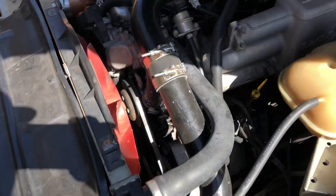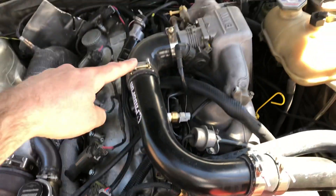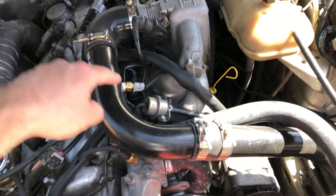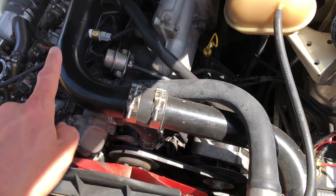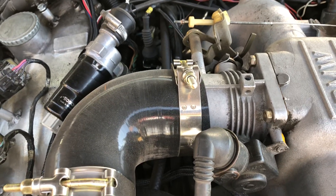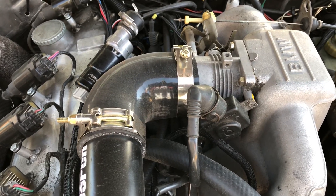The intercooler bends were perfect — I found them in the junkyard. They're heavy duty, just a long L-shape, back to back, so you come out up and over with one link in the middle. You need a 3-inch to 2.5-inch silicone reducer — or it might be 2.75.